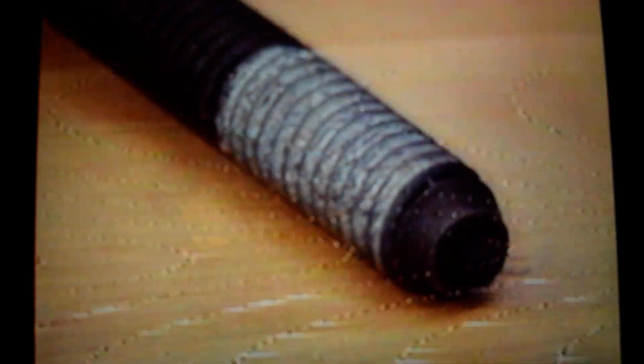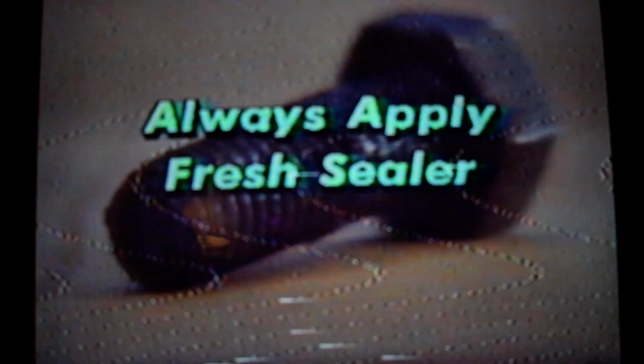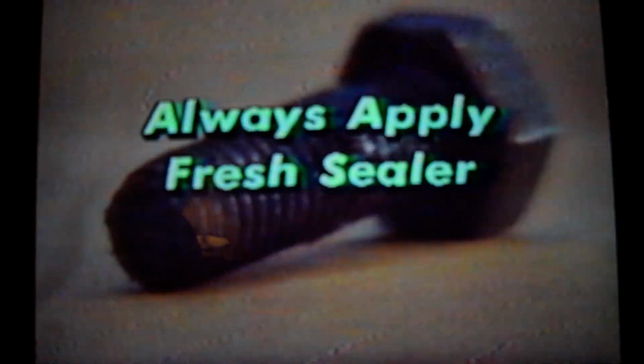The primary purpose of pipe compound is to form a seal that prevents oil and moisture from penetrating the threads. But since it fills the space between threads, it also helps to prevent threads from moving against one another and working loose. To aid in production, many new original equipment bolts are pre-coated with thread sealer in a dry form. When these bolts are removed, some compound remains on the threads. However, for best results, fresh sealer should be applied.